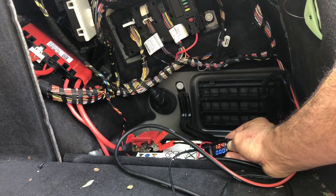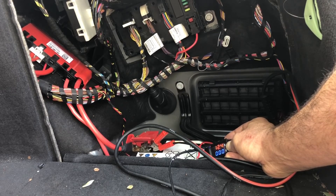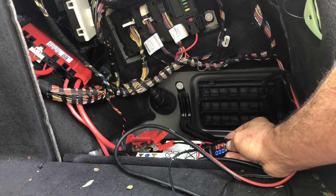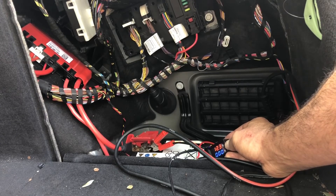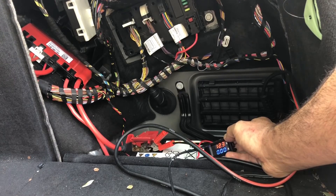This means the car should be fine even if you start it after two weeks of sitting. I've seen a few cars drain about 0.4 to 0.5 amps, which is huge — the battery will be drained in two to three days. You have to understand that, because buying a battery is the simplest thing, but it's not always the real problem. As long as it doesn't go higher than this range, it's good.